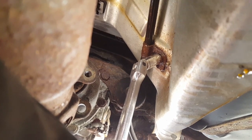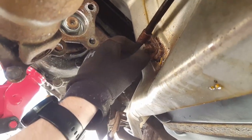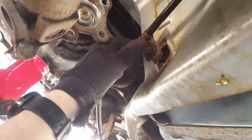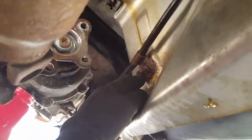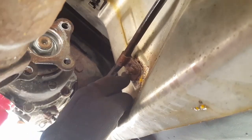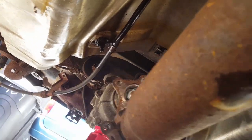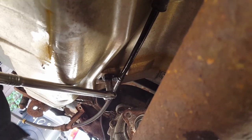I'm using a number 12 socket to remove the brake line bolt. This is pretty hilarious — I didn't even put any pressure on it. I didn't even try to turn it yet and the metal just rusted out, and this whole thing popped right off. That's fine — when I put this back I'll just try to jam it in that hole and see if I can figure out somewhere to keep it up and off the ground. Hopefully the passenger side bolt comes off pretty easily. This is just screwed into the gas tank heat shield, so it's not a big deal. I just have to keep the brake line up and off the ground and out of the way of any moving components.